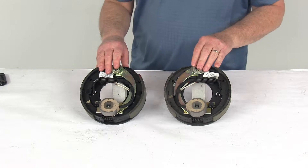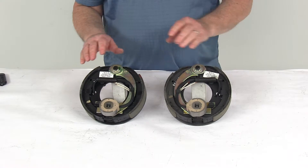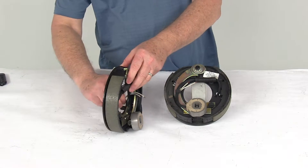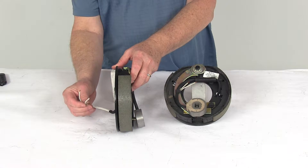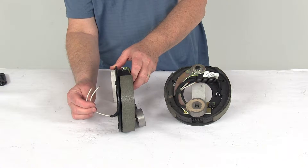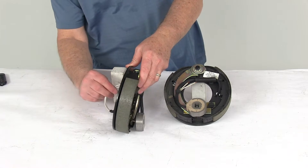These brakes are QAI and CSA certified. Electric brakes require the two wires in the back to be connected — one goes to a ground, the other goes to brake feed for power. They're white wires, so you can use either wire for either function.